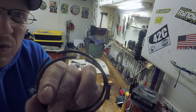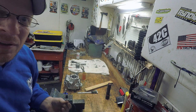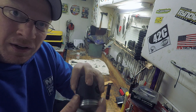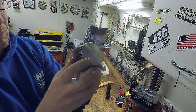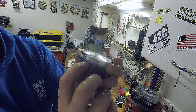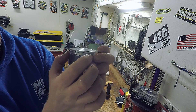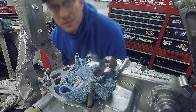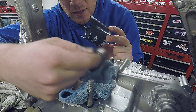Sometimes you have to take the wrist pin and push it through the other side just to get the clip to snap in. The piston rings are etched with a T — that means top, plain and simple. Oil the living crap out of these — I put two-stroke oil on them. Make sure you get the rings lined up with these pins: there's a pin right here and a pin right there. You can see the gap — take the gap and put that over the pin.